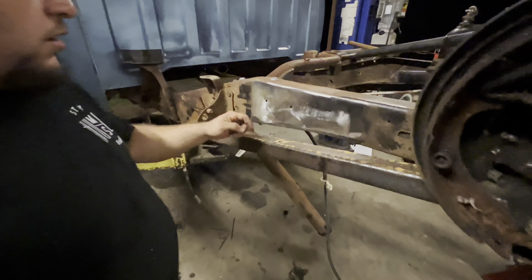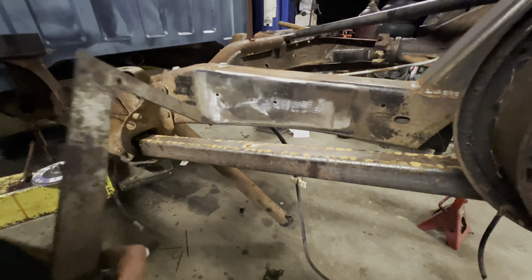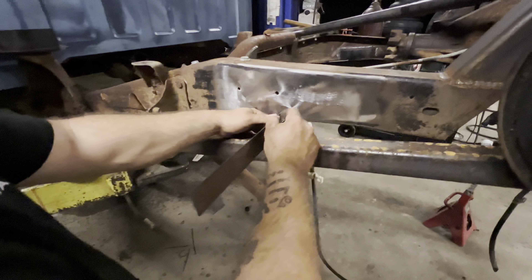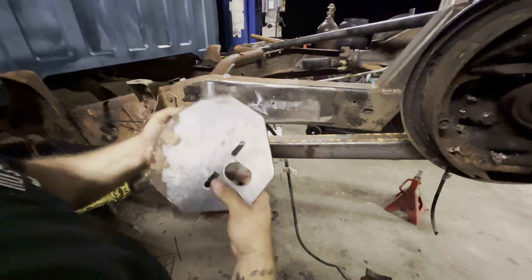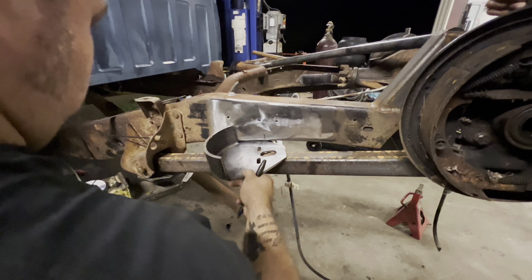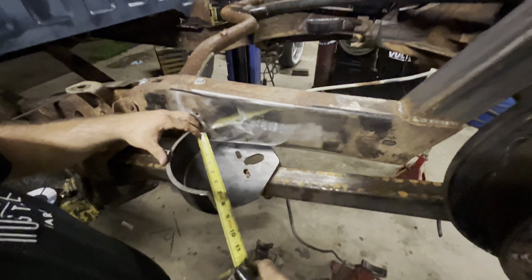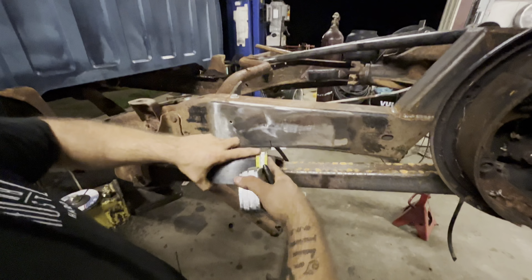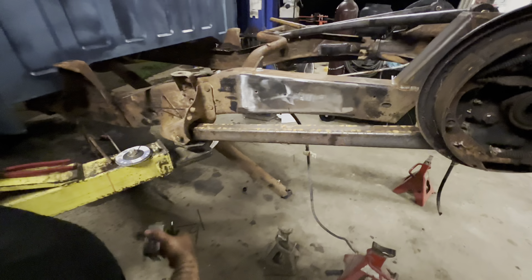So Infamous pre-drills your hole for the bottom bag bracket. We're going to center this top bracket over that — just going to put the center out there. Here's your upper bag bracket; it's going to recess into the frame like so. First thing we're going to do is measure across here — that is 8 inches, which means I need 4 inches on each side of that line cut out. And it is also 2¾ inches tall, so we're going to need an 8 inch by 2¾ inch hole there.